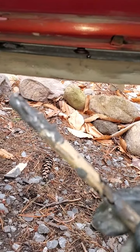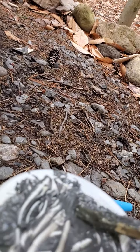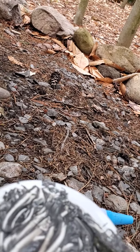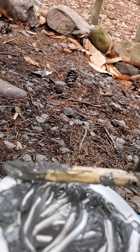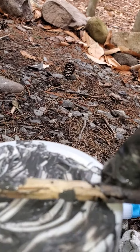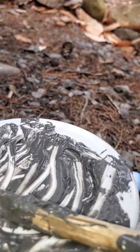I'm almost done with my little mixture. Using the official stick of epoxy — a little dab will do you. I'm doing about two and a half feet of weather stripping, so four or five beads should be fine. The stuff's really strong. The crazy glue is going to hold it in place while the epoxy is setting.